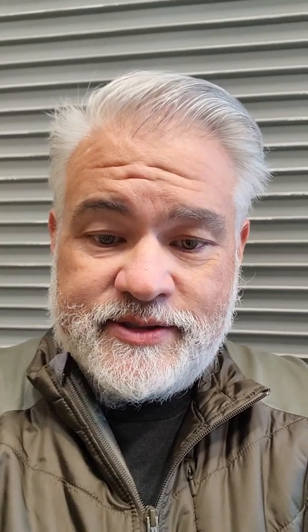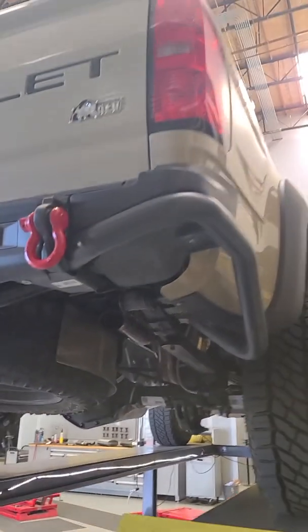As we get back under the car, we're going to go ahead and do our preliminary testing. This testing is based upon both noise — with our RTA real-time analyzer, which will give us dBA ratings as well as the frequencies we're working with — and seeing if the cancellation chamber is working correctly. We're also going to test it on the butt dyno to see how response feels, and ultimately back on the full dyno to find out what it does there. More coming soon.